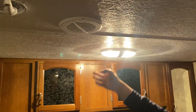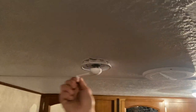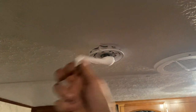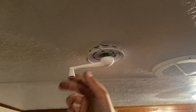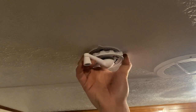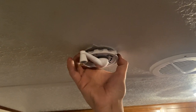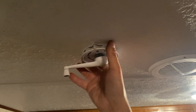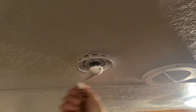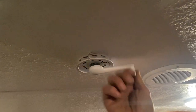In the bedroom the light is on its own center switch. The antenna control is here too: turn the knob to bring the antenna up. Once it's all the way up it stops in place; pull down and rotate it to find your best signal and leave it there. Before traveling, line up the two arrows and bring it all the way back down — this ensures the channel the antenna sits in is lined up properly.